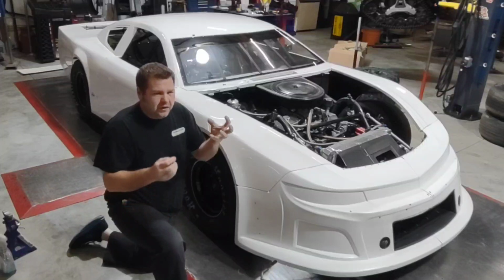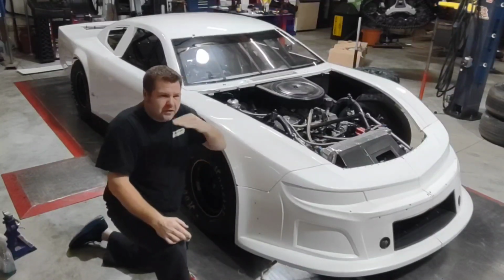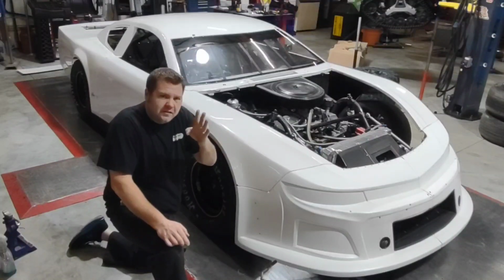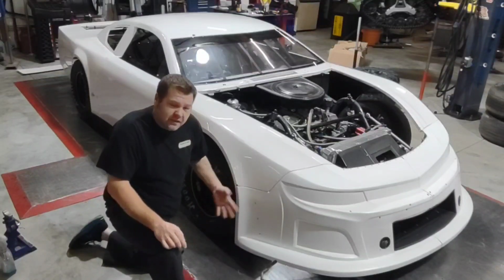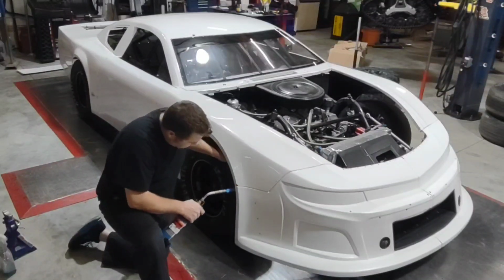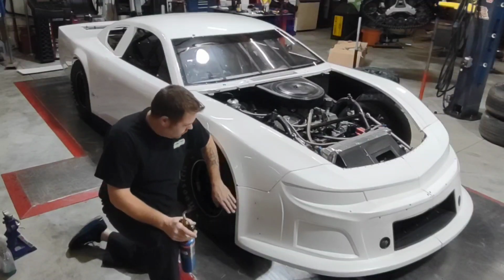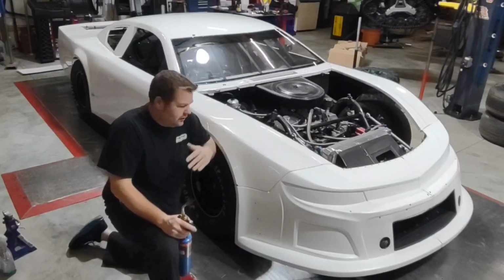Unfortunately, when you use sandpaper, it gets this fuzziness, this hairiness, because that plastic kind of stands up. It's not brittle enough that when you sand it, it just shears that off. It's soft enough that it curls up and stands up, and then you have this fuzzy patch. That's easy to get rid of with a little bit of heat. If you just take your heat gun or your blowtorch and roll over it nice and smooth, you don't want to get it so hot that it deforms, but that heat will burn those little things down and kind of flow them out a little bit.